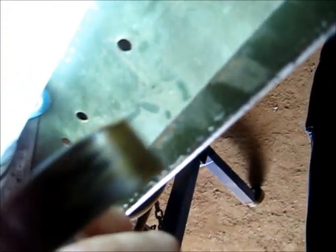It's pushed to the side and actually ground that off. Lucky there wasn't any serious damage done - the crank only had minor damage to it. So only one cylinder needs attention, and it'll have to be reground and should be fixed, hopefully. You can see where the oil journal holes are supposed to be. There were bits of bearing material in the oil journal hole, but not too bad. The oil journal holes were blocked up by that bearing. That's a wrong bearing anyway. That's what the bearing is supposed to look like - that's a good bearing. That's a bad bearing. You can see the difference.